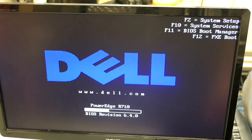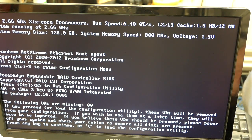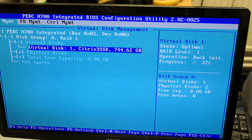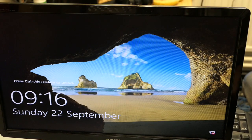We're back - the clone is done. Pop the older hard drives back out. Going through the RAID configuration utility - it confirms I've popped the original two drives out so that other virtual drive doesn't exist anymore. The RAID is syncing up - just OK that and let it reboot. It booted up normally - take the old drives out, plug it back into the cabinet, and we're good to go. The whole thing's back up and running.